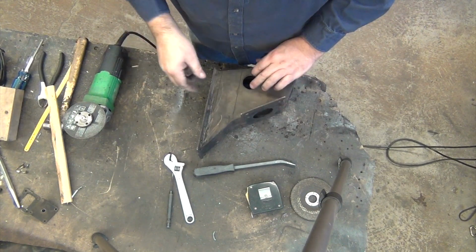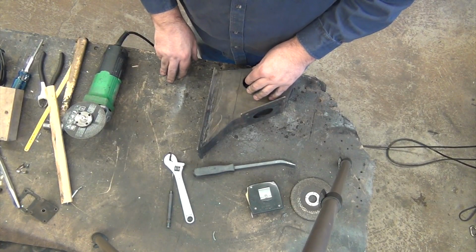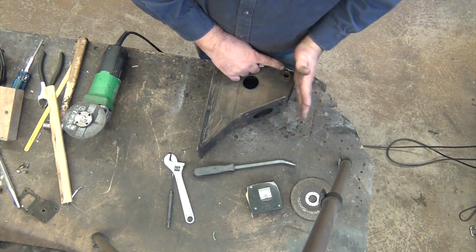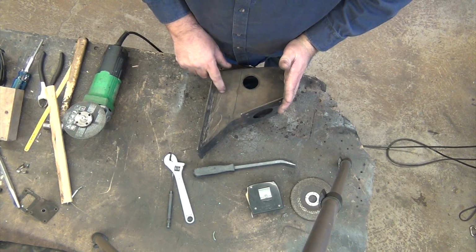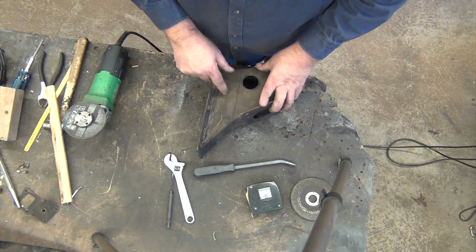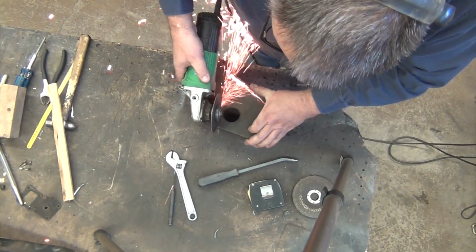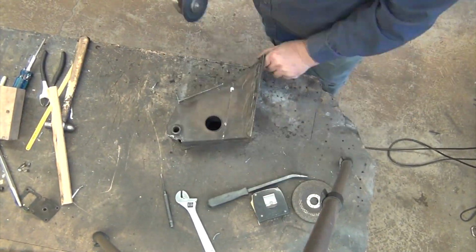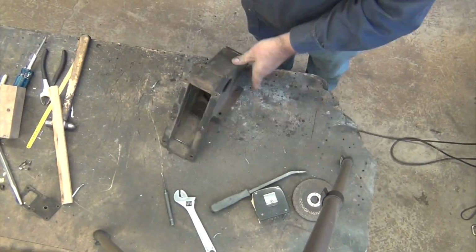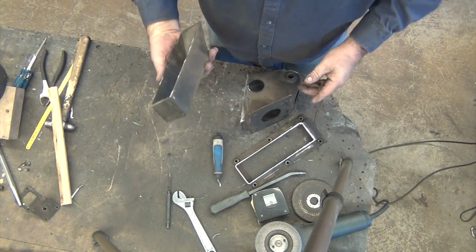Alright guys, it's kind of hard to film it underneath the hood there, really dark and the angle's really tight, so we put it there. As you can see by the still picture, we've gained about 1/4 inch, and by the time this slides forwards about ½ inch, we'll gain like ½ inch, 5/8 in the hood dropping lower, so that helps. So we're down to 2 inches here, better than 2.5. We've laid out 2 inches to take out of here, and there's no going back. Let's put the grinder in here, drop it 2 inches, mock it up and see what she looks like. Alrighty, so there's our 2 inches out of there.